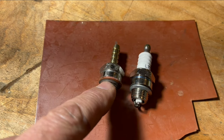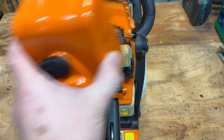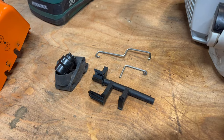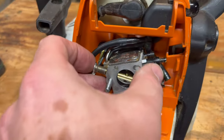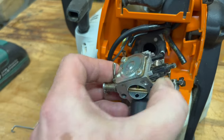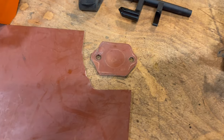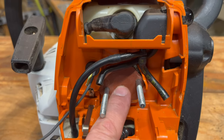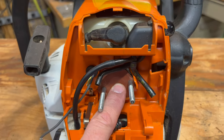You can also buy these with the link in the video description. We'll start by taking the cover off — 5/16ths nuts, filter, pop off a few linkages and hoses, and then the carburetor comes out. Next, I trace that gasket onto this material and cut out this piece with no hole in the middle. Our newly made gasket seals the cylinder from the intake side, and we replace the carburetor and the air filter.